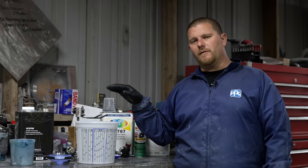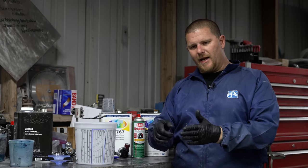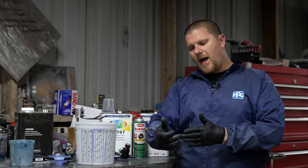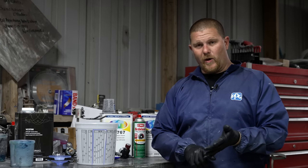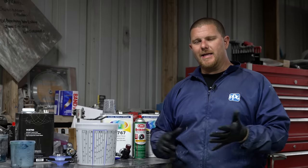But the reason that we don't flow coat is because if you did 3 and then you sanded it, well, how many did you sand off? Did you sand off 1 coat? Did you sand off 2 coats? And then you did a second round another day, you just had to resand the entire car. And if you don't have a tape line, it's not necessary.